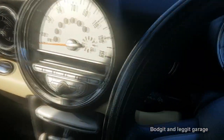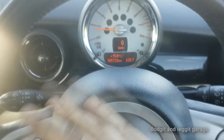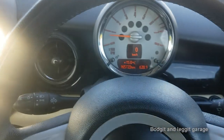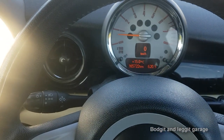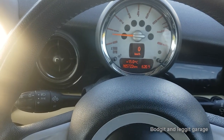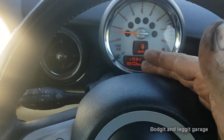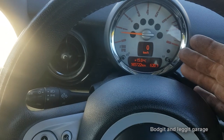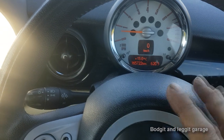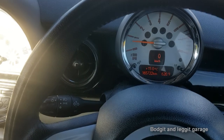Just be careful when you read error codes. We had an airbag light come on here — it had nothing to do with the airbag system. Read the codes properly, and don't be afraid if you've got three or four faults across three or four systems, because it could just be one fault. It's experience that leads you to that one fault, because otherwise you could be chasing airbags and doing hours of work and getting absolutely nowhere. Read your error codes properly and you can pinpoint the issue.